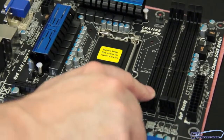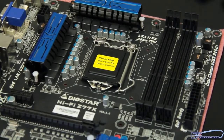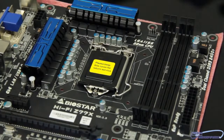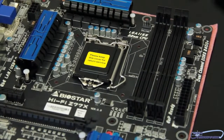Over here to the right, we have the memory. 32 gigabytes, DDR3 memory, dual channel. It says it's certified for up to DDR3-2400. When you're overclocking, that number will probably go down, but if you have an XMP profile that you want to engage, it'll do that.